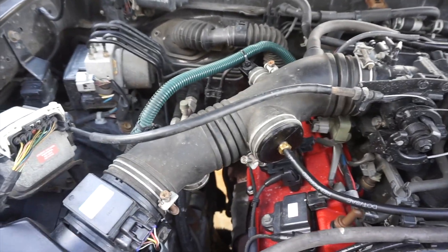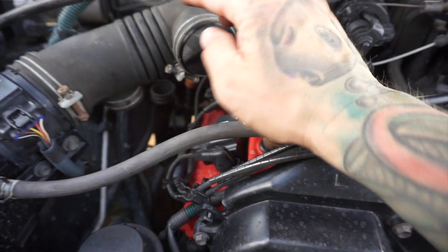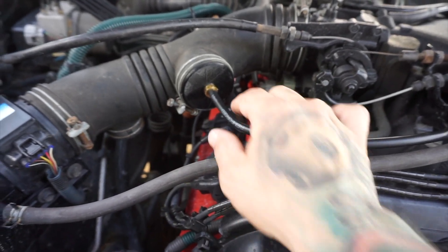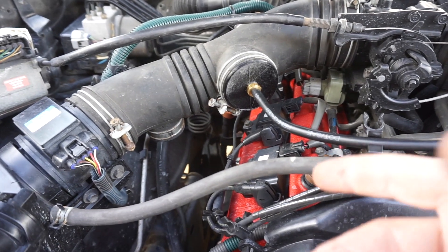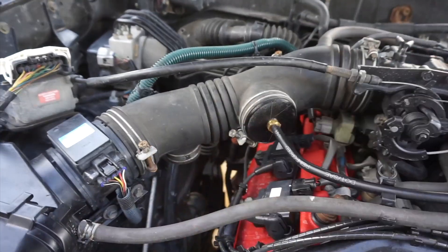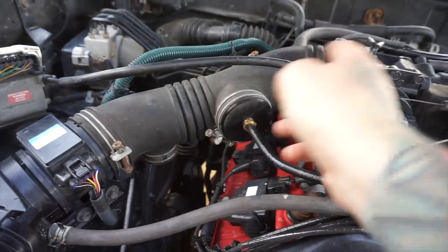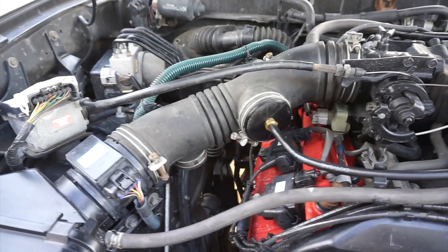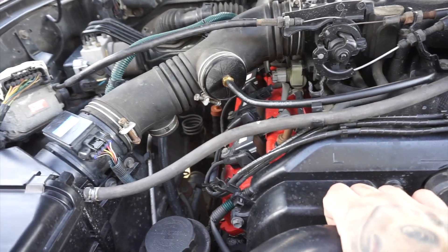I'm probably going to make several sets of these. I'm even going to make another one that has two holes in it, because I guess some of these 4Runners had a vacuum line that led down to the power steering — mine does not have that, but I'll make that optional. Then I'll probably put the brass nipples in and try to sell these. If you see these and you like them, shoot me a message or leave a comment and I'll find a way to get them to you at a fair price with shipping. It's a super simple swap — you don't have to duct tape anything, you don't have to buy Toyota parts. A lot of people try to swap these with newer ones from the junkyard or buy them from Toyota for like 70 bucks, and even with those you need to modify them by putting a piece of aluminum pipe in and finding a nipple. This here seems like a pretty all-in-one solution. I don't think it will cost more than 20 or 30 bucks with nipples and shipping, plus a little bit for my time and trouble.